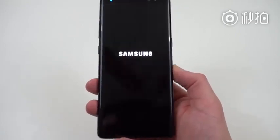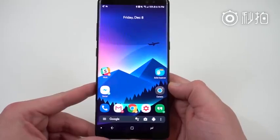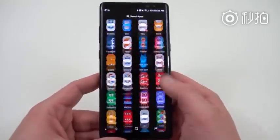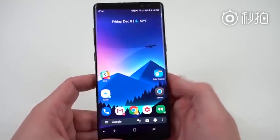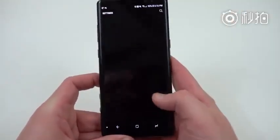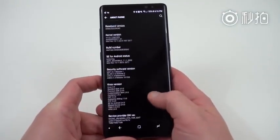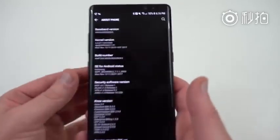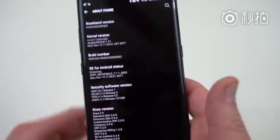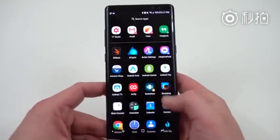Then I'm going to rename the Oreo update to update.zip so I can go ahead and flash that. We're back from doing the Nougat BQK2 build. I just want to verify the build number is correct — I didn't lose any data. You should make a backup whenever you do something like this, of course. Let's go into About Phone and scroll down to confirm the build number. You can see right there we are on BQK2, so we have the correct build number to proceed with flashing the Oreo build.